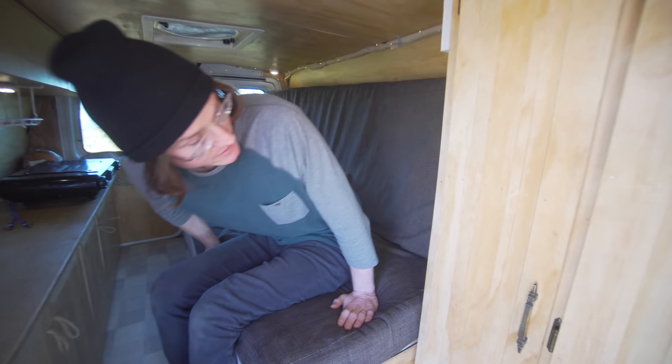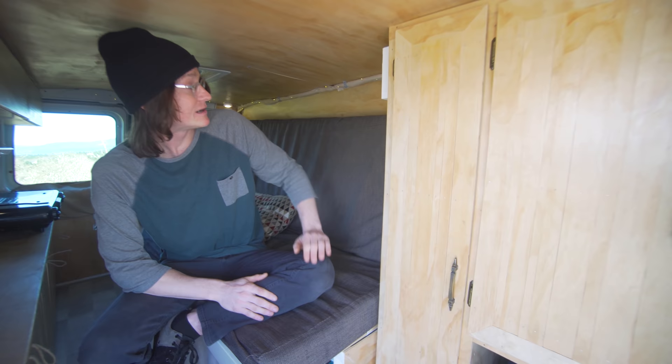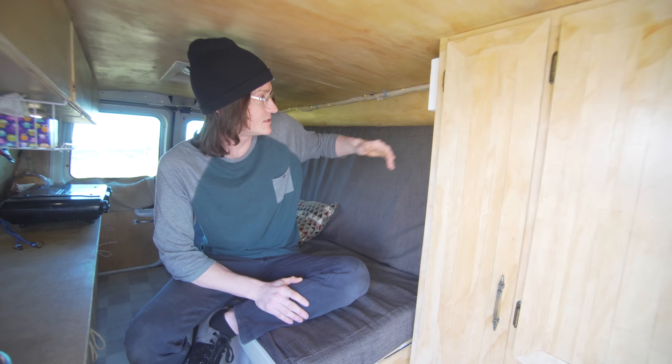With the actual plywood, it's very cheap — about $13 for a four-by-eight sheet — which was really nice because it's thinner and actually hugged the contours of the van, which helped a lot with space. I used self-tapping screws to tap into the parts of the van that were a bit proud, to tie it all in.